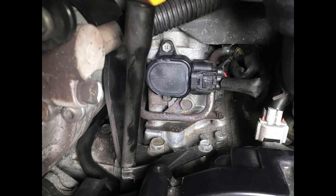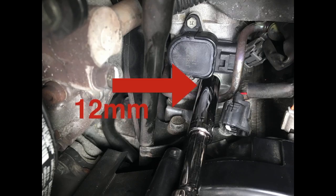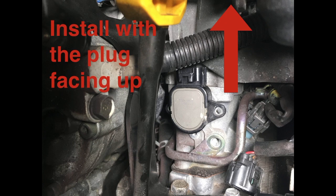You can see the position sensor installed. You need a 7 millimeter socket to get to those two screws to loosen the throttle position sensor. You also need to remove this 12 millimeter hard pipe bracket, otherwise you can't rotate the position sensor to uninstall it. With that bolt out, you can twist the old position sensor up 90 degrees and then remove it.